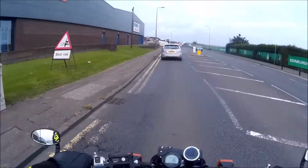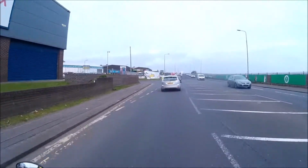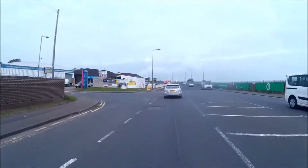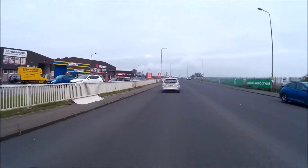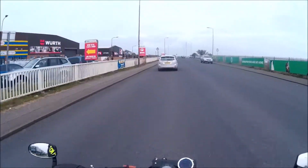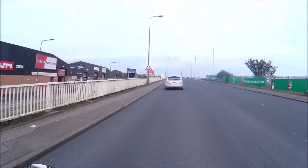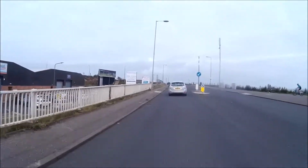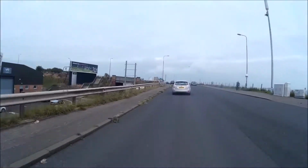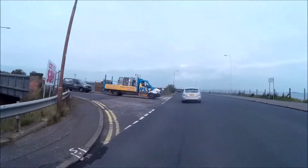Right, I think we need a little more fuel at the low end, just for takeoff, and a bit more fuel at an earlier point on the throttle, and a bit more up to maybe a bit higher than 20%. See, look at that, that's 28 miles an hour. This is going up a hill. That's pretty good. Normally it'd be struggling. It's definitely getting more fuel. Excellent. Right, back to base, and then we'll make some alterations.